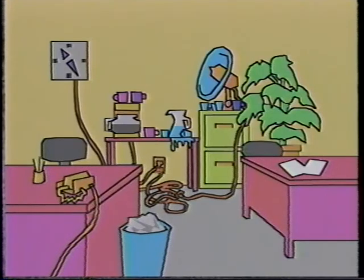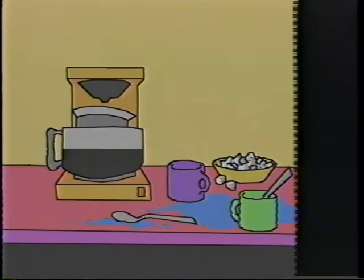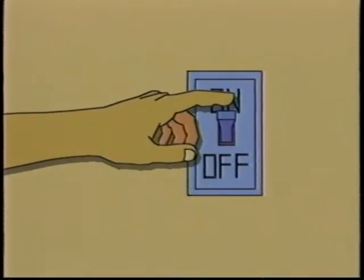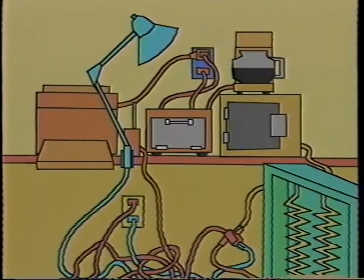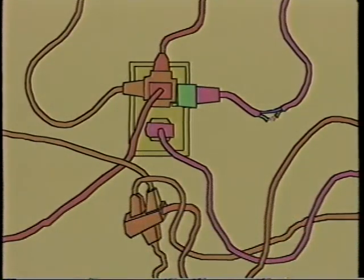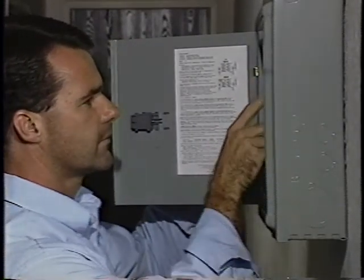The office can be a very dangerous place for a computer system, but with a little planning you can provide a safe and practical home for your new computer. You'll need a separate electrical outlet for each piece of equipment in the system. Be absolutely sure that your HP 3000 isn't plugged into an outlet that's controlled by a switch, because if someone flips the switch at the wrong time, your computer could lose power or data. You don't want your system connected to the same circuit as machines or appliances that cause heavy power drains. And don't use extension cords — they can be fire hazards as well.